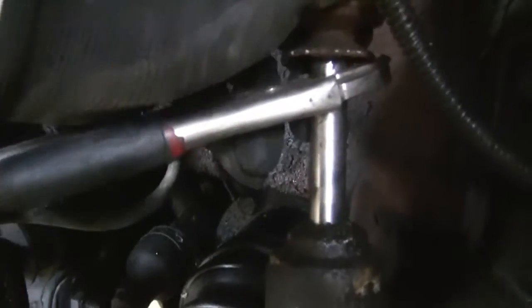Hey guys, it's worth mentioning there that even though I said you could have it up against that brake line, I don't recommend you have no hands on the vice grips, because there is a brake line there. Brake lines are delicate, especially if they're rusty, so be very careful that you don't just spin it off and hit the brake line, because that's not ideal. We'd be creating a pretty big project, flaring and bleeding brakes. Not fun when you just want to install some shocks and jump. So, we continue. The old Pro Comps. These guys probably don't have that many miles on them.